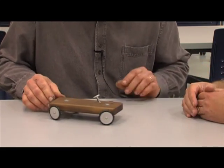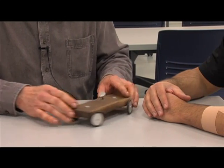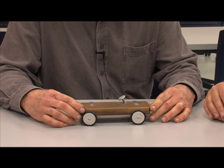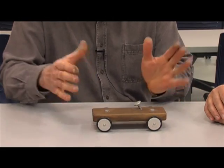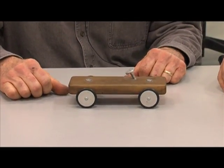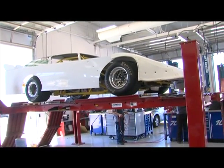So with the gas pedal, the rear of the car, as the car rolls over, will actually steer around, as well as when you are on the gas, the car will hike up. The rear end tries to drive under the car, which raises it and causes the rear end to steer. So it literally does dynamically steer the corner based on what you're doing with brakes and gas.